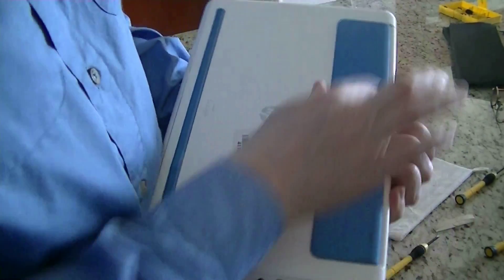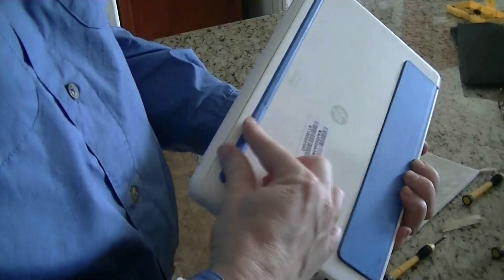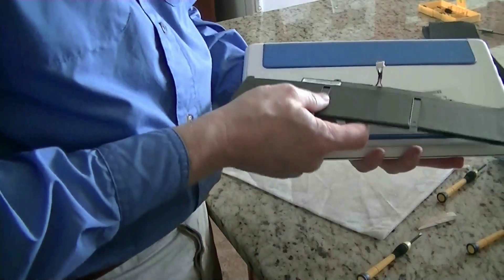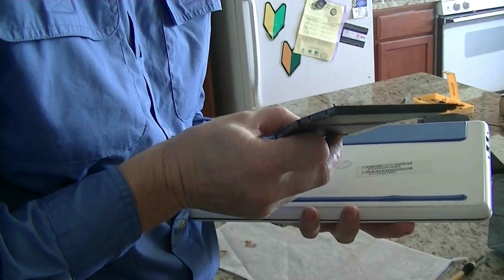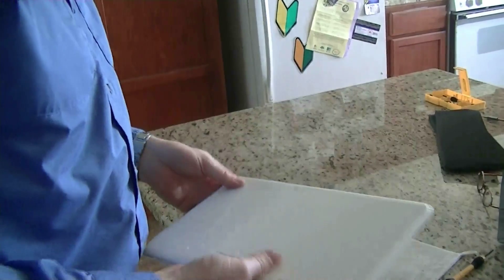That's pretty easy. Remember: to get into this, you just pop off the foot pegs, take out the six screws, pop this one open to get the screw here, do this side to get the screw here, the back comes out, and there's the old battery sitting right in there. This battery's model number is SQU-1208, and this is for an HP 11-inch Chromebook.